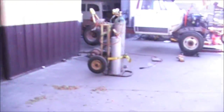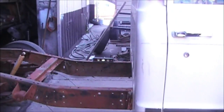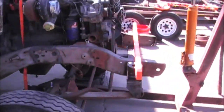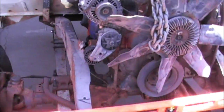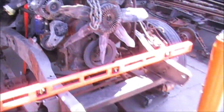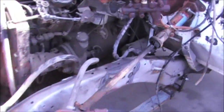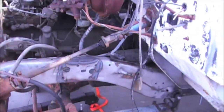So this is where we're at right now. As you can see, I've got a level on the front, a level there, a level on the frame right here. Anytime I'm doing something like this, I'm running all the way around the truck with levels, looking all the way around it to make sure that everything is square and level and true, because this is the time that it will really bite you in the butt. Doing it the way I'm doing it is the best way if you're going to be mounting an engine into a truck, because you could take measurements all day long and then weld the mounts in, but there's nothing that's going to tell you how it's going to fit in the space like using the engine itself as a jig. So if you're going to do any type of work like this, you've definitely got to have a good picker — a good way of picking them up — and that'll help you get everything in there. As you can see, it's going to fit nice and easy.